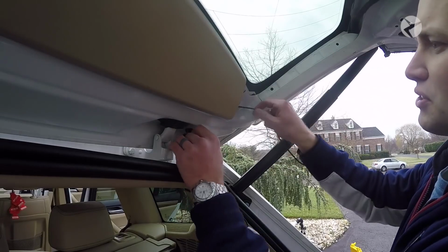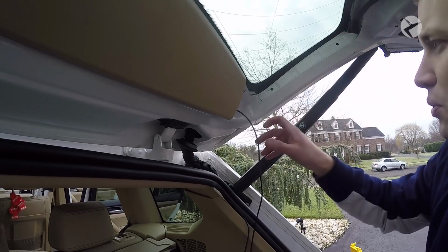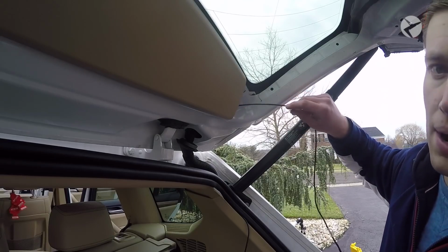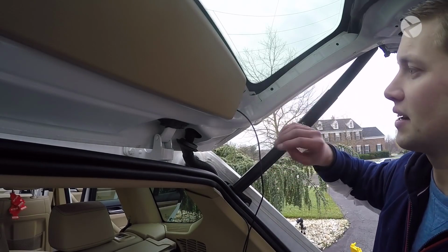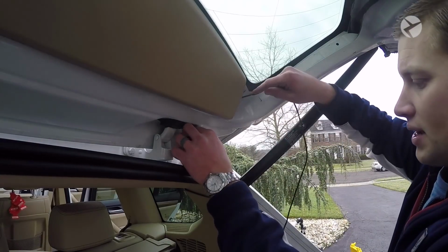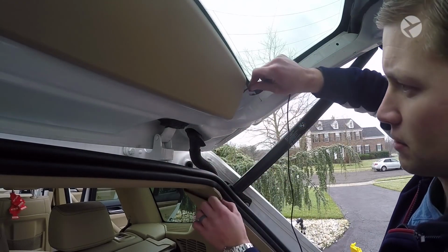Now there's a couple ways you could do this. You can run a feeder through this piece of metal right here on the inside where the actual harness is. The only reason that I like to mount it to the outside is you can actually tape it down, so you might not have any tapping. You're not guaranteed to have that if you have it on the inside, but I like to be able to secure it down with some electrical tape just to make sure that we're not going to have that. So you're just going to need to pull some more through. Just be very gentle.